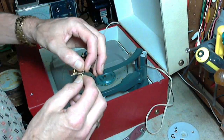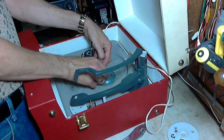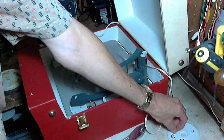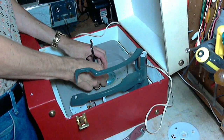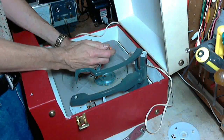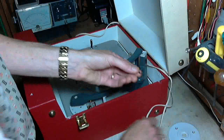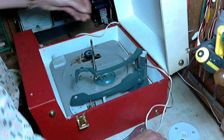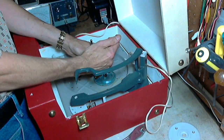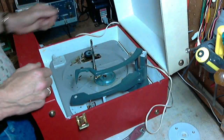I don't see any grease or contamination on this part. Throw it back in — it's moving very freely on its pin. Start putting these C-clips back in before I forget. That's a very common thing — get the whole record player back together and then look down and you've got two of these C-clips still sitting there. Put this one back in too. These things fly going on and off.